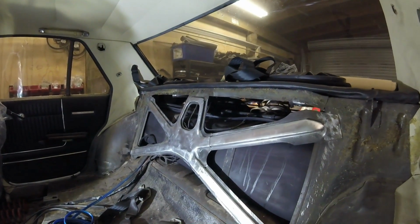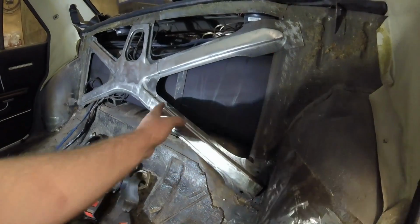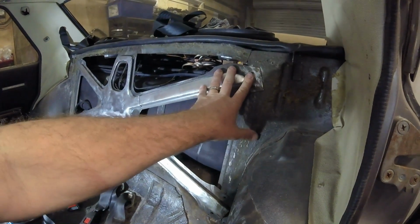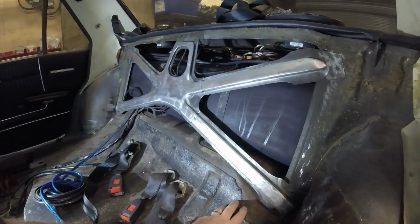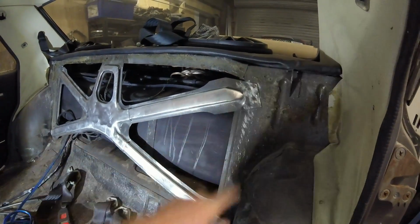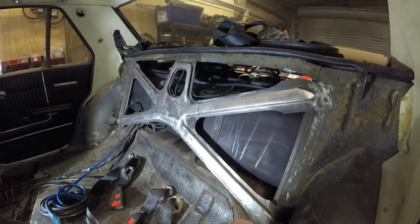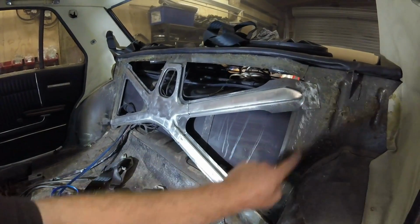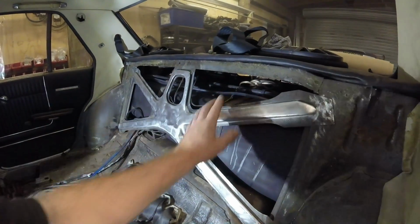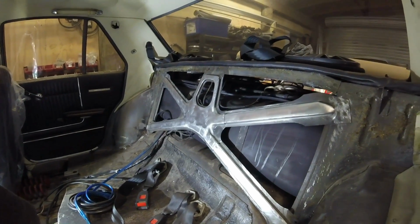So traditionally most people will just use aluminium panel. A couple of ways to do it on this one, because these areas are raised up here to give it some strength. That makes it a little bit harder than what it could be otherwise to seal it properly, or at least try to seal it. So you could put one big panel and try and deal with this issue here and this issue here, or do what I'm thinking I'm going to do on this one, because it won't take terribly long. Just cut out whatever it is, 5 different pieces, or it's more than 5, 6 pieces, and just fill in this area here, because that's a nice flat piece there. Same deal there, all of them are nice and flat, and you can get a good seal easily, no dramas at all. By good I mean relatively airtight, not 100% completely watertight obviously, but I don't think that's what they're after.